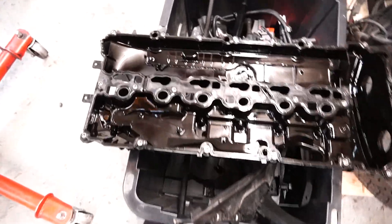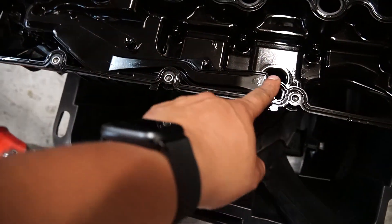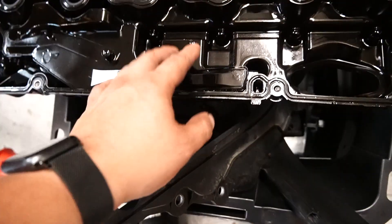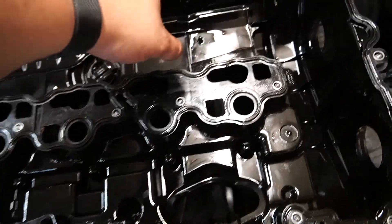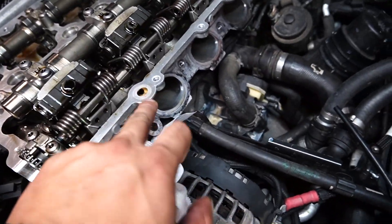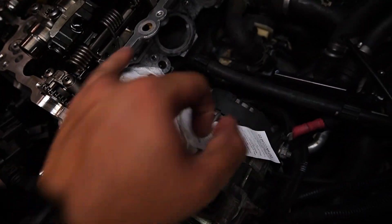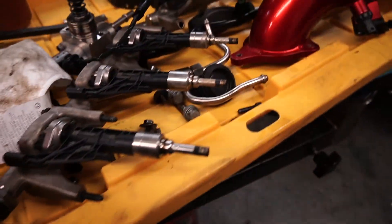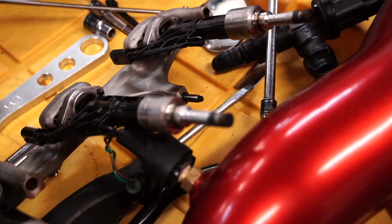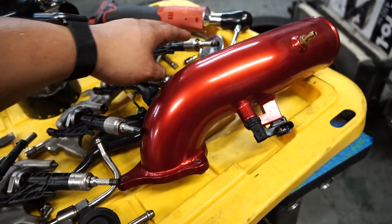Here's the valve cover — the PCV system is right here. You have the high side which feeds through here and the low side which goes directly to the cap. We don't need to plug the high side; we're plugging these holes on the head. What was happening is I was seeing oil make it into these runners — if I stick a rag in there it comes out a little oily. Because oil was making it into the combustion chamber, the injectors were a little bit covered in oil. That's also a sign your PCV system may be shot.